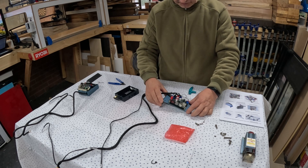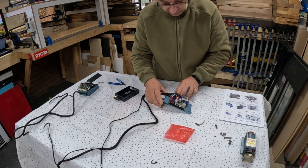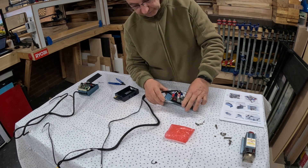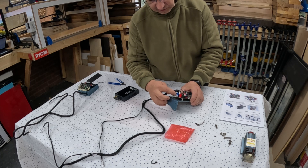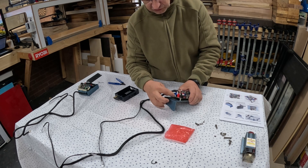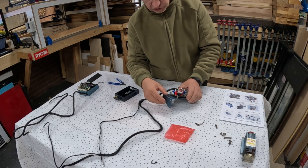And there you have it. Just make sure you double-check with the instructions to confirm you've got them all correct and haven't made a mistake. There's one thing to be careful of — they're all colour-coded, but this blue one here, which is the power, does not go on the blue one on the inside — it goes on the white one on the outside. So just make sure you check that and you should be right to go.